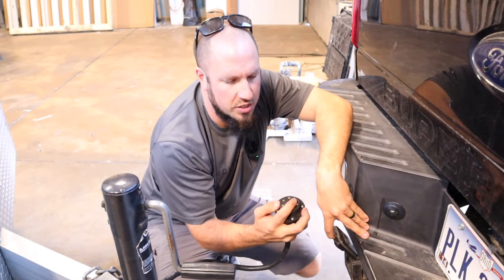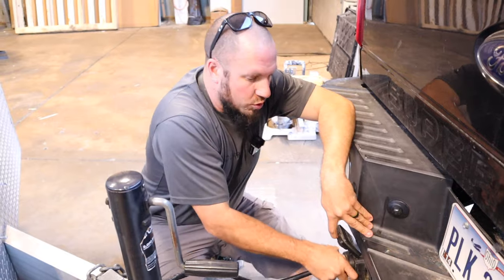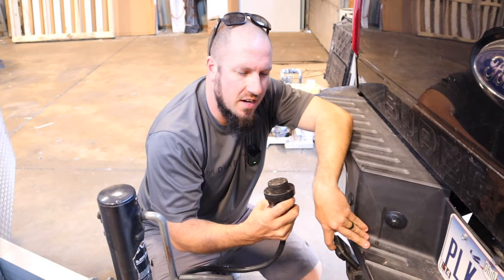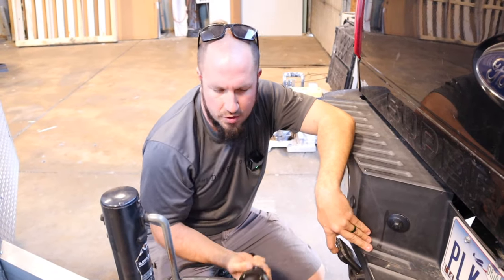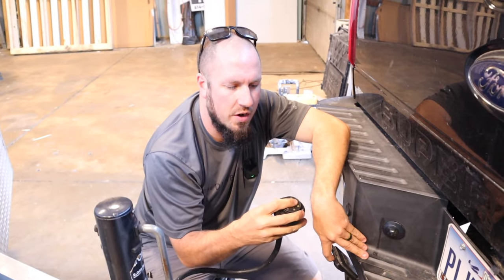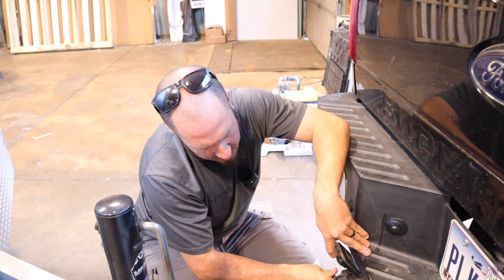This has a really strong magnet with really positive engagement, and it is really hard to get apart. What happens is this magnet attracts all the crap from around your hitch — anything metallic will pack up on the front of the connector, which also keeps it from getting a 100% connection.